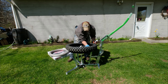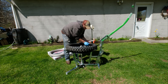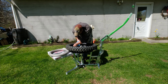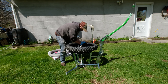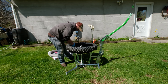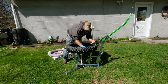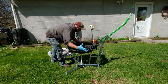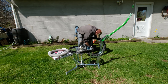Riding at AOAA trails there is a lot of water, so a lot of people use Murphy's tire soap — try to keep it off the bead. Since we ride in Pennsylvania where it's fairly wet, you definitely want to keep everything nice and lubed. I'm already getting the stuff over my rim, so I'm going to put about three quarters of this lube inside the tire.